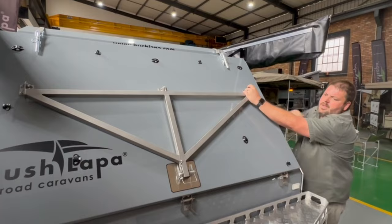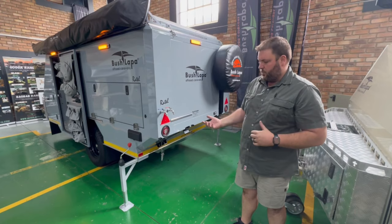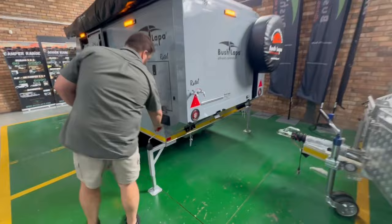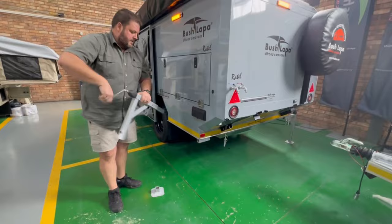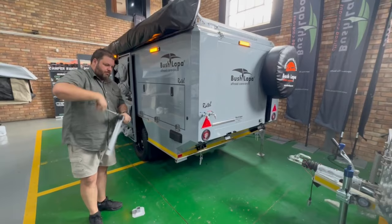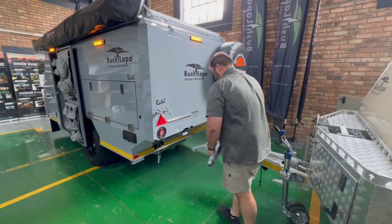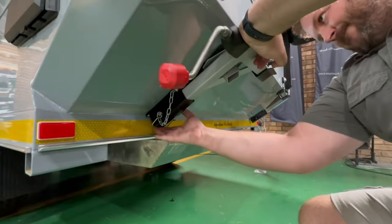We're quickly going to show you how to use the stabilizers or jacks. They do both — you can use them to stabilize and level the trailer, but you can also use them to jack up the trailer and change the wheel. They might be a bit short on the rattle, so you may need to put something under the jack depending on the angle of the terrain, but you will be able to jack up and change the wheel and carry the weight of the trailer. Take it down, stack it in, take out the base — the base slides into that bracket inside the triangle and then you've got a locking mechanism to keep it in position.